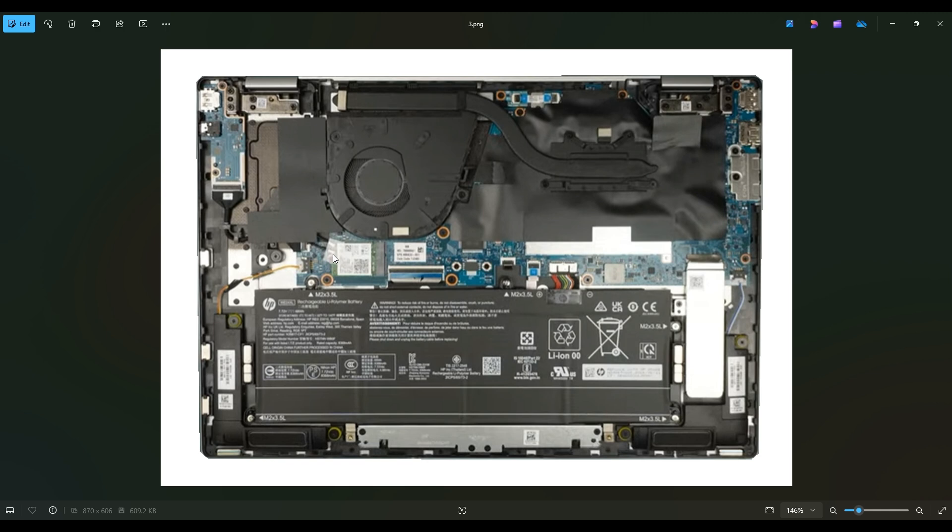I will also have the Wi-Fi card info below in the description. These are 6E Bluetooth 5.3 wireless cards. Now, if you're having Wi-Fi issues — if your computer's not seeing any networks or not able to attach to any networks — it could be a bad Wi-Fi card, but it also could just be a driver or a system issue. Before replacing your Wi-Fi card, try troubleshooting first. There will be a video link above and below in the description showing you how to troubleshoot a laptop that's not finding any Wi-Fi.